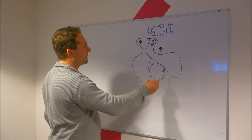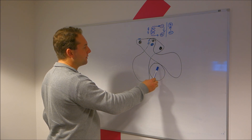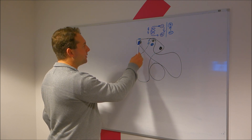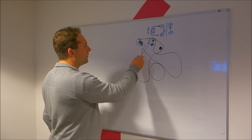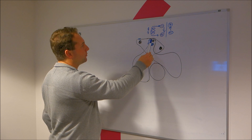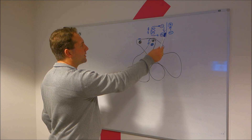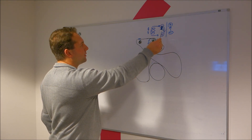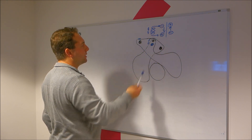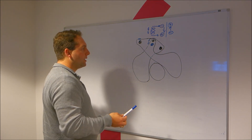The shutter has two very small plastic blades. Here is the opening for the CCD, and it has a few flaps behind that as well. Each blade has one and two fixed points, plus a common moving point. This activator is moved by an electromagnetic coil — as the polarity is inverted, the coil moves down or up depending on the polarity applied on the wire. It's a really simple and clever solution.